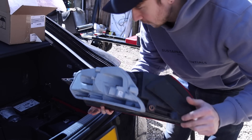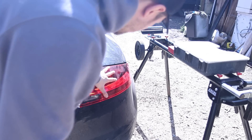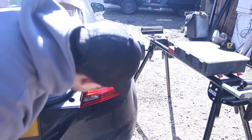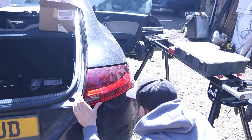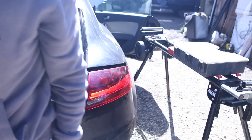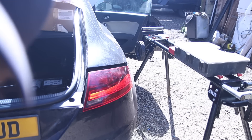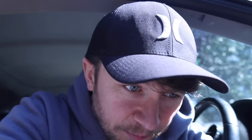Before I go ahead and fix it, I forgot to show you what the actual issue looks like. This one was in the early stages of going, and as the MOT said it still had some bulbs working but not all of them. Looks like now it's actually completely gone — so within the past couple of weeks since the MOT it has completely stopped. And then obviously from inside the car it warns you with the double speed indication light and clicker, which is really annoying. Even when some of the bulbs were working last week it still does that double click because it's sensing more voltage going to the rest of them.